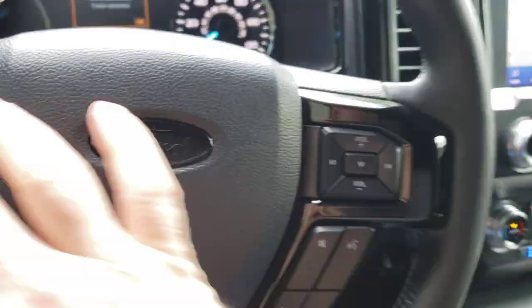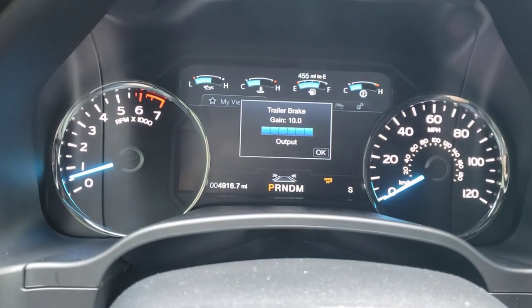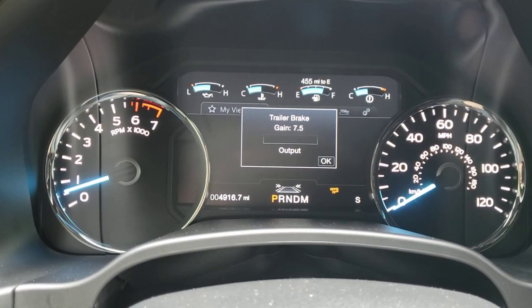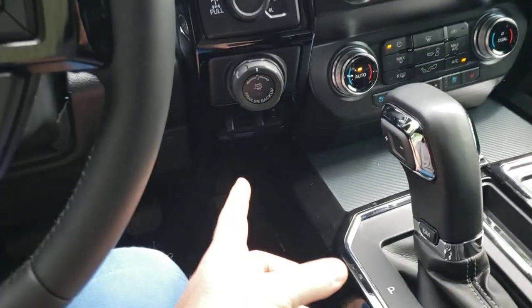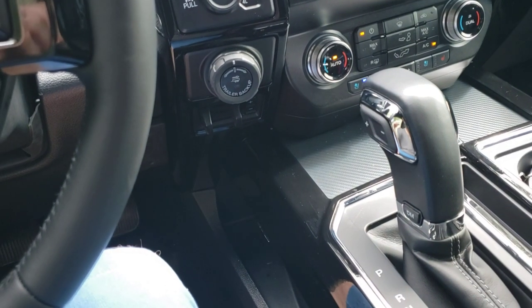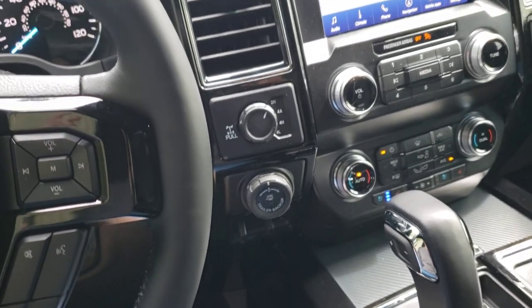With the truck on, I squeeze the trigger and it pops up — I can push plus and minus to change the gain. I drove my little trailer around my property to test it, and everything worked great. Squeezing the trigger while driving engaged the trailer brakes, and hitting the brake pedal also activated the trailer brakes.